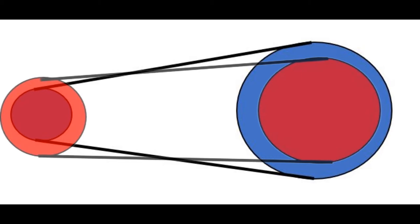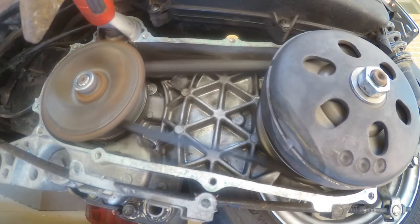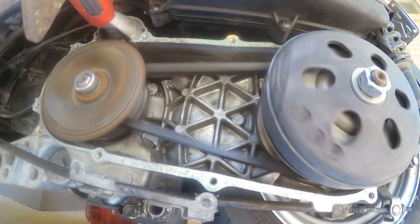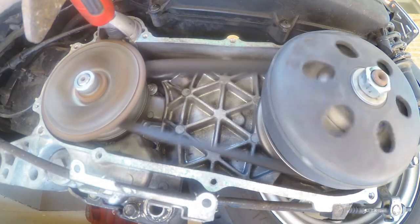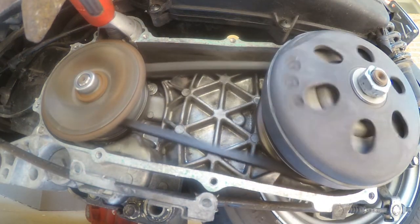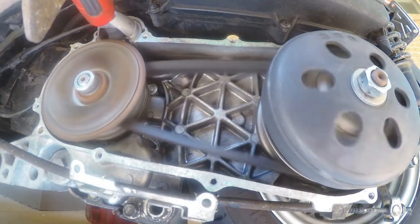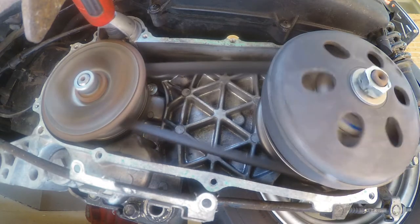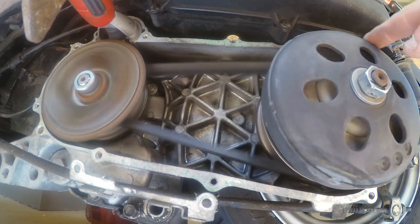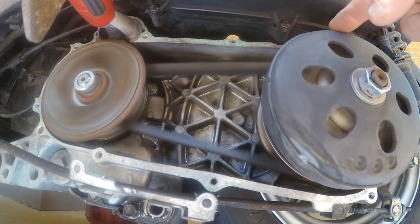So with that said, let's start this scooter up. Okay, so we can see here the rear wheel is moving at idle. Now don't be alarmed — it's because the rear wheel is elevated and there's no resistance from the ground. Ordinarily at idle the scooter wouldn't be moving, or it shouldn't be anyway. As a demonstration, I'm just going to show you that if I put just a finger on the outer part of the clutch here — and I heavily suggest you don't do this at home — you'll notice that the rear wheel actually stops, because these two components are connected.